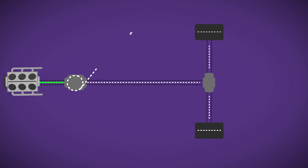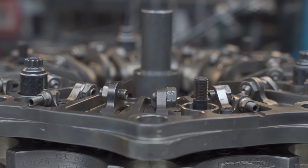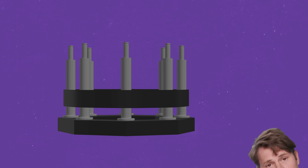Not to oversimplify things, but you probably know what a clutch does — it regulates power from the engine to the drive shaft and ultimately to the wheels. The purpose of a Top Fuel clutch is the same as in any other car. You can think of a Dragster clutch setup like a sandwich. Within the bell housing, you'll find the highly tuned Top Fuel centrifugal clutch. At the engine end is the flywheel, which forms that all-important connection to the Dragster's 11,000-plus horsepower, and the flywheel would be like the bottom bread of our sandwich.